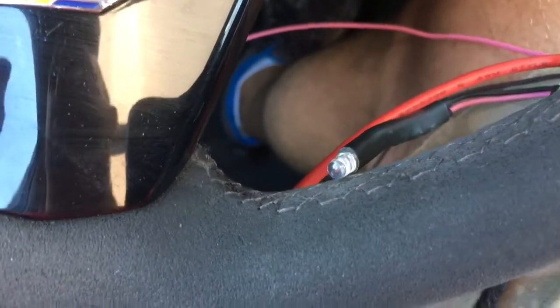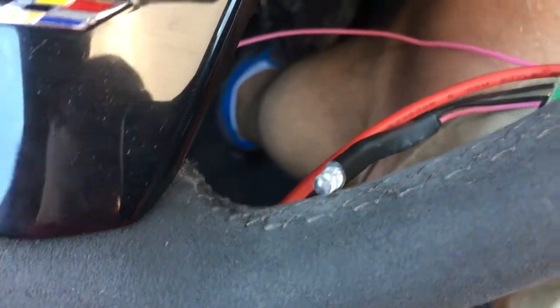What's cool about this is you can actually choose the fuel flow rate when high flow mode activates. This puts a lot more control in the end user or tuner's hands as far as when this pump is going to kick on. You can dial in and turn it on right when you need it instead of turning it on at a preset boost level or using a hobbs switch or whatever. Basically this makes it true on demand so you can figure out exactly when that factory pump is running out and run the auxiliary pump.